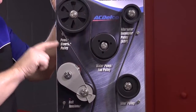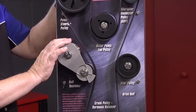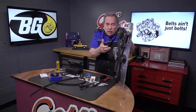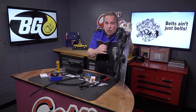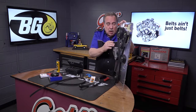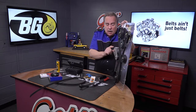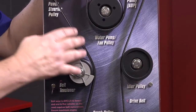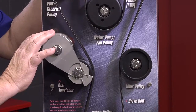This belt is kept tight by a belt tensioner. One of the complaints when the car comes in is that the belt makes a noise when I first start the car — a screeching sound, or when the car idles it gets this chirp chirp chirp sound. The first thing you check is the belt tensioner, because if it doesn't keep enough tension on the belt, the belt can slip and you get a noise.